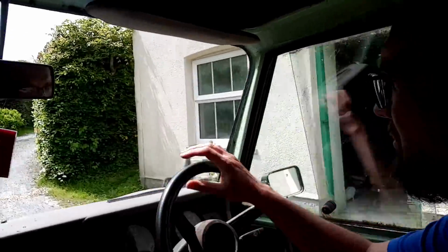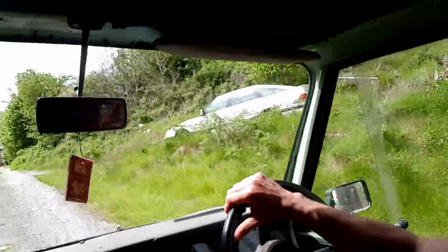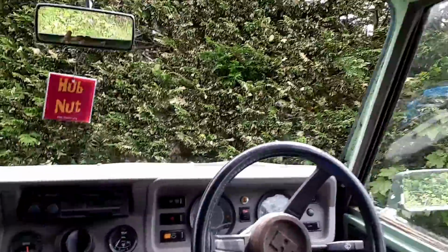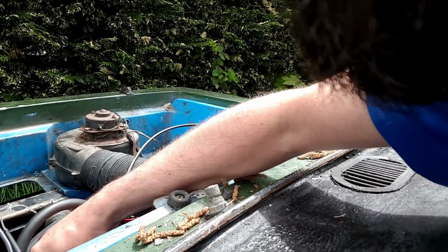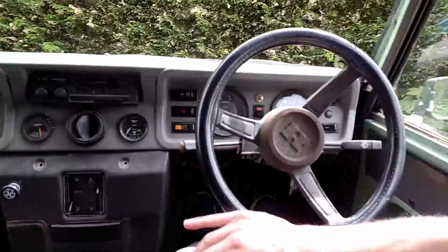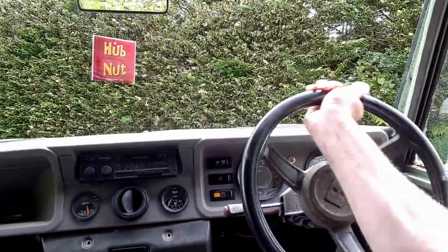You can definitely hear the induction of the engine. Let's go for a drive with no windscreen. Oh, that's quite refreshing. That's over choking now, and I can only access the choke through the engine bay. There we go. Choke control adjusted through the engine bay. So now I can put her in reverse and reverse up. Oh yeah, now she sounds sweet.